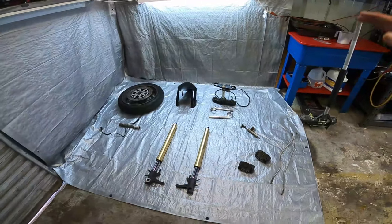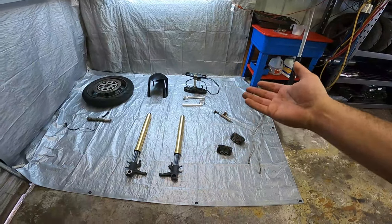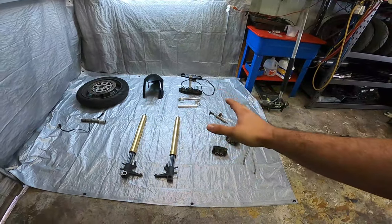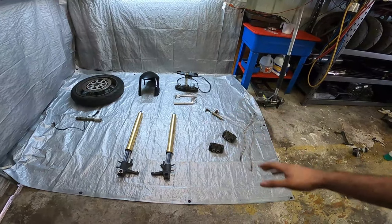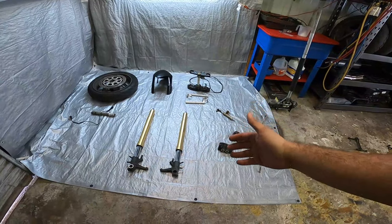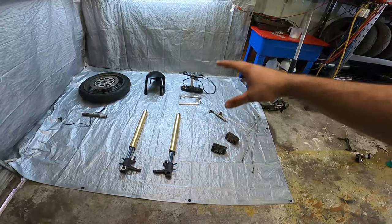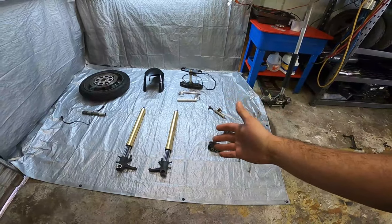This is a very cool swap — it makes your SV650 look significantly beefier than factory. I highly recommend it to anybody that actually knows why they're doing it, not just for cool factor. Even if you are 200 to 250 pounds, you will still need to have these forks rebuilt, sprung to your weight, and heavier oil added to make it a comfortable ride. But the extra points of adjustability are always a plus and they just look way better aesthetically. I hope you found this video helpful — if you did, please give it a thumbs up and smash that subscribe button. We are literally like 90 subscribers away from 2,000 subs!